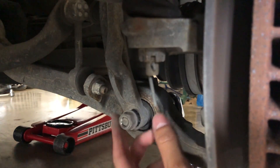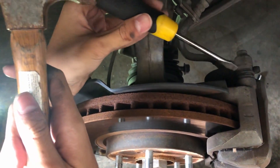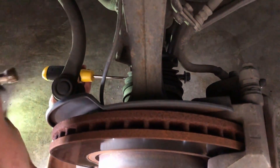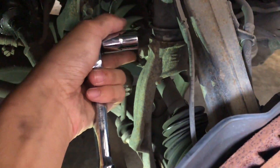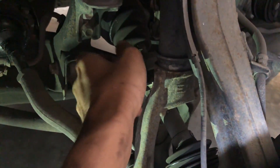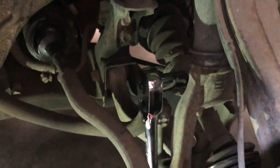You should be able to take it off easily. To get the bottom nut out, you need your fork and a flathead screwdriver — just stick it in the hole and the bottom fork should come off easy. Put the nut back on just a little bit so when you're tackling this bolt it doesn't slide around. It says 10 millimeter on there but it's actually 14 — grab your 14 and break it loose, then take it off.